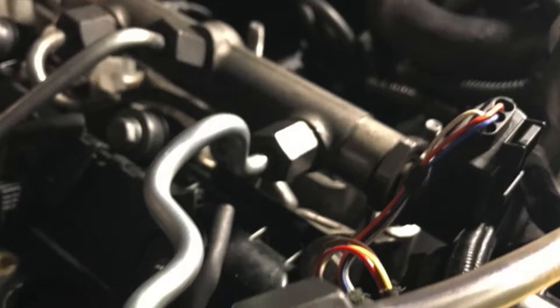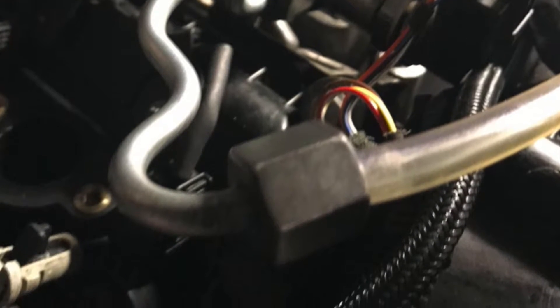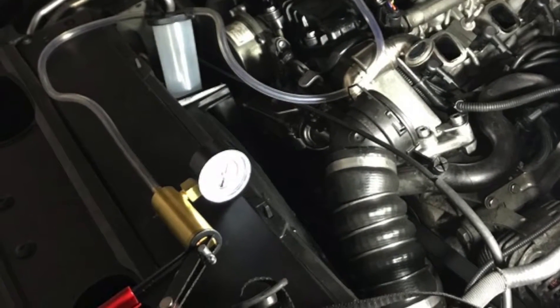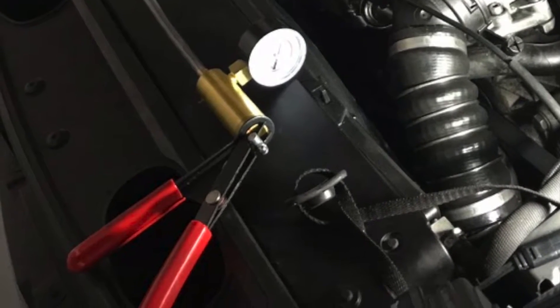As you can see here, this is a picture of one of the fuel lines. I could see that there were air bubbles in it and these had to come out. I had a budget vacuum device from Amazon for about 15 quid which I thought I would use for this application. I hooked this up to one of the injector pipes, then put in a little bit of hose and a catch can to retrieve any diesel and air that was going to come out, and on the other end the hand vacuum pump to draw the vacuum.